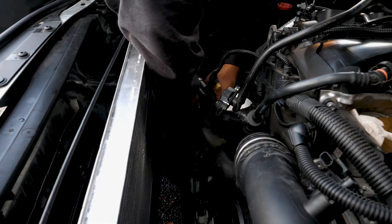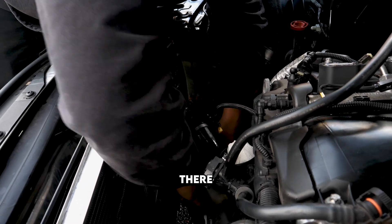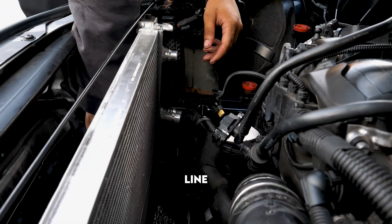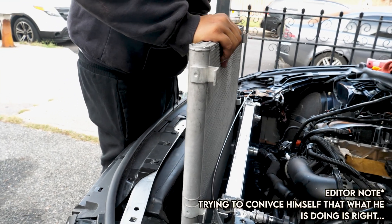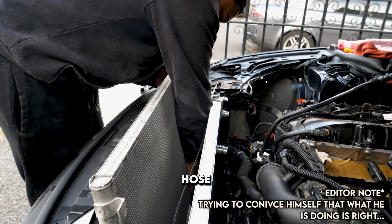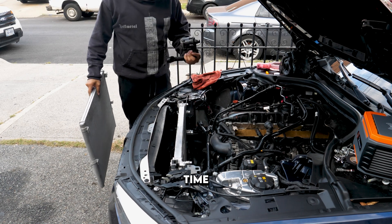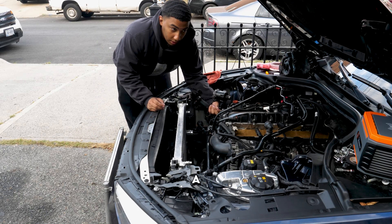Now you have the connector on this side — you want to mount this onto a bracket right here. Secure it down once you've got everything positioned. We now have the line over here to connect to this right here. Drop this in carefully and get it in the easiest way. You've got to finesse it a little. I'm going to make sure I get this hose because it's not going to lock. You have to lift the radiator up — it's time to get this cooling line to fit in between the radiator and the frame. I suggest you have somebody to help you.